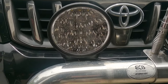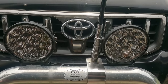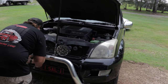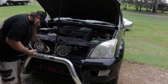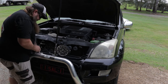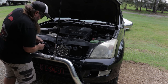There are the current 7-inch Kings lights on the Prado — complete with cobwebs. We're going to have to probably move this bracket because the bigger lights won't fit with it. The lights we're pulling off are a pair of Kings Dominator Extreme 7-inch LED driving lights — they put out 1 lux at 1 kilometer and 13,000 lumens, and they cost $90 from 4WD Supacentre. On the other hand, we've got the Auxbeam 9-inch spotlights that put out a combined 37,000 lumens. I can't find any lux stats but I believe it's also 1 lux at 1 kilometer, and these ones cost $330. So how do they stack up against the cheap Adventure Kings? Stay tuned to find out.